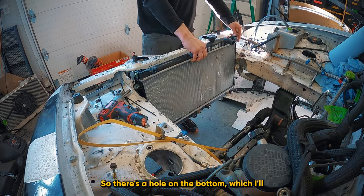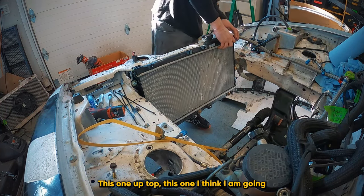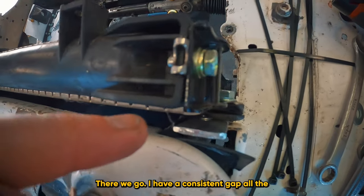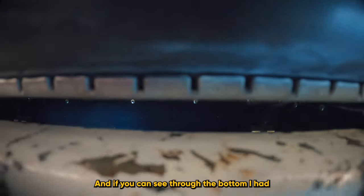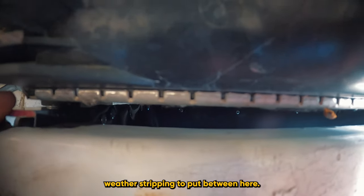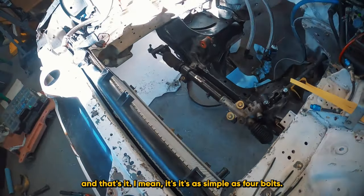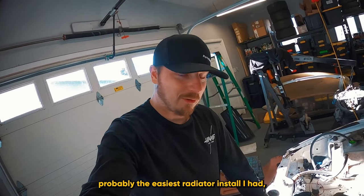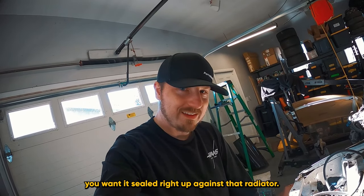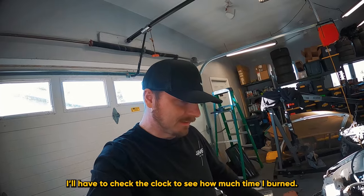This has the brackets I'm going to put on the new radiator, but it just slides right down. There's a hole on the bottom which I'll show you from underneath. I may have to tap the bottom bracket. I have a consistent gap all the way down the sides and on the bottom. My plan is to get the appropriate weather stripping to put between here — that's going to seal it up nicely, give it a little bit of a cushion, and it's as simple as four bolts. Probably the easiest radiator install I've had. The factory one is only two bolts, but once you add in the ducting it really gets messy because you want it sealed right up against that radiator. I'm super happy with how this turned out.